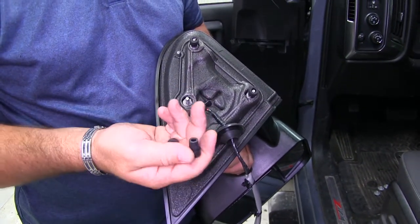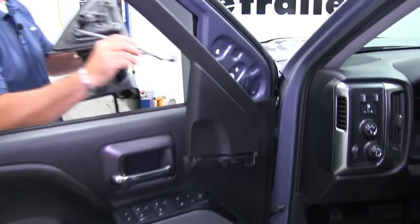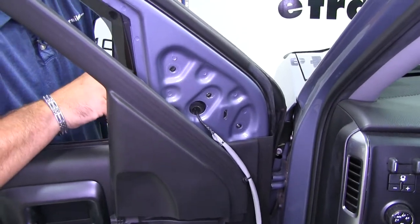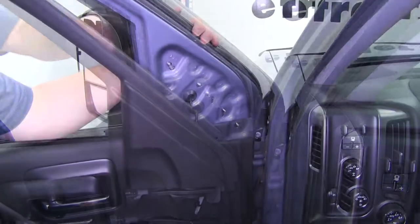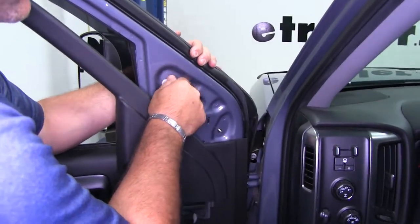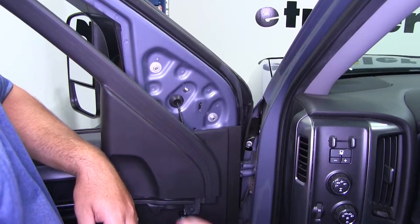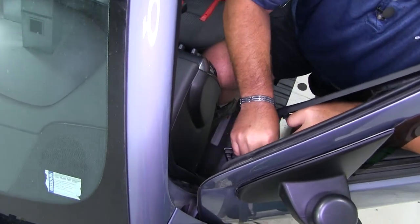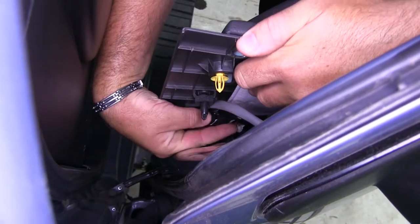Next, we're going to have some little rubber covers — go ahead and pull those off. Starting from the outside, we're going to feed our wire through the large hole. We're going to line up all of our screw holes, making sure you get that grommet in there. Now, your kit comes with four nuts, except the nuts are smaller than those holes, so I recommend using your factory ones that you took off. For the fourth hole, use one of the new nuts from the kit and put a washer on the back of it. Then we'll reinstall our new wire using the new pushpin fasteners in the same holes as the factory ones, get the plug lined up, and just push it into place.